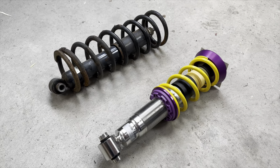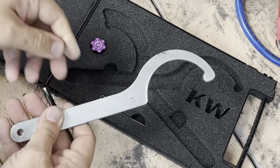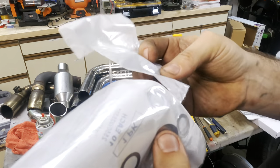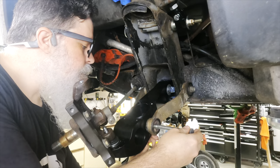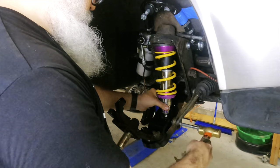But before I seat the ball joints in the knuckle, I need to put in new coilovers. These are a DeLorean-specific kit from KW — they even have photos of the DeLorean suspension system in the manual. The ride height and stiffness are fully adjustable, and they're a lot safer to handle than the old just-waiting-to-kill-you springs. The only slightly odd thing is that the fit in the control arms was a tiny bit loose — there's a very small gap between the shock pivot and the inside of the arm, maybe half a millimeter, and as you slide the shock back and forth you can hear it click against the arm. These solid billet arms don't compress the way stock LCAs might. My solution was to order some thin shims from McMaster-Carr. I found that two 0.1mm shims got rid of most of the shifting. They are kind of a pain to install since you have to balance the shims right on the very edge of the bolt while inserting the shock, but it worked and the play is mostly gone.